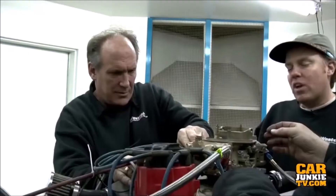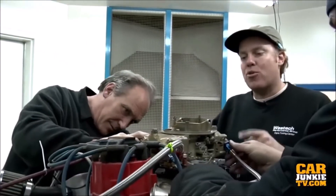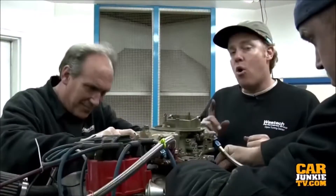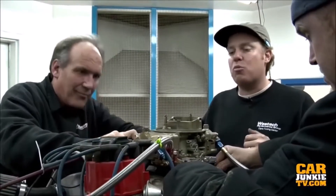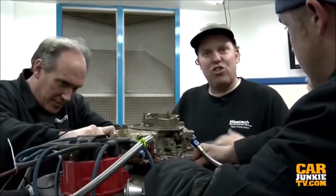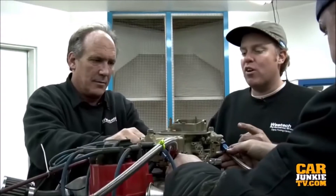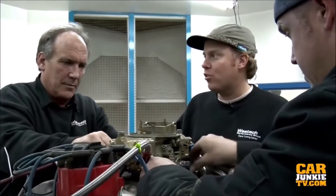It's not really intuitive why that would happen because it didn't do it with the RPM air gap. So we're a bit conflicted about whether our problem with it not metering at 2500 at wide open is because it has so much airspeed that it's pulling a lot of fuel and going fat and misfiring, or if the airspeed is so slow that the fuel is just dripping and not atomizing. With this open spacer on here, in theory if the airspeed is too slow, this will make it worse, right?